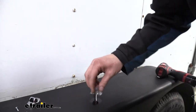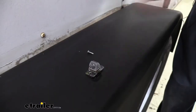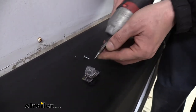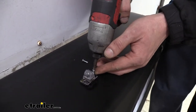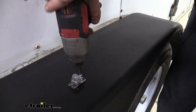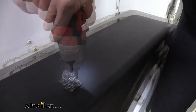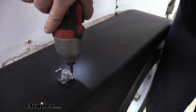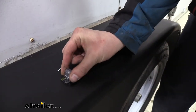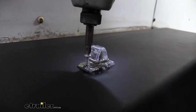Making sure we keep it oriented with red towards the rear, we're now going to make sure our light is centered front to back so it goes straight down. Then we're going to use small button head self-tapping screws to run it into place — you can get these at your local hardware store. We'll leave it just a little bit loose so we have some play to make sure it's straight, and then run in the other self-tapping screw.